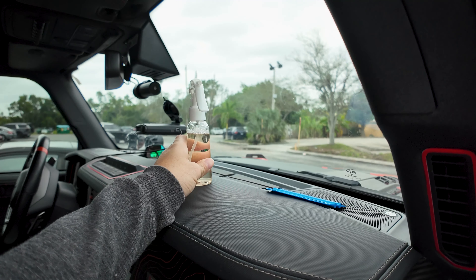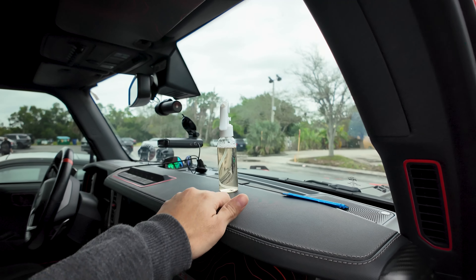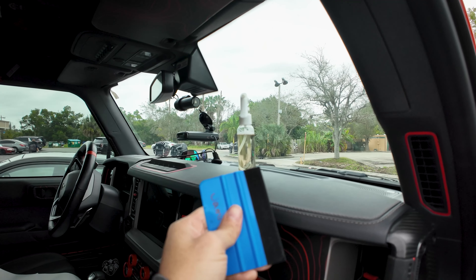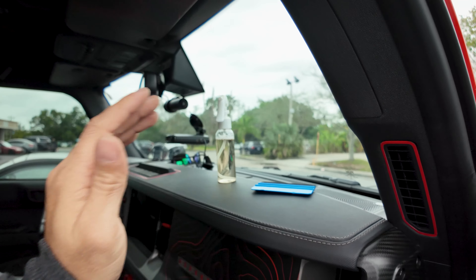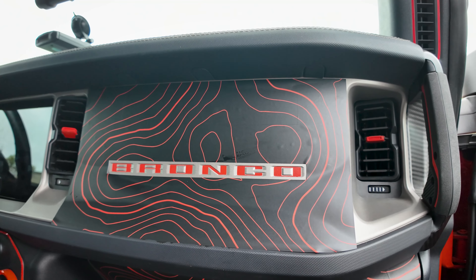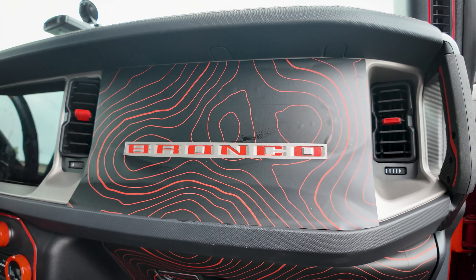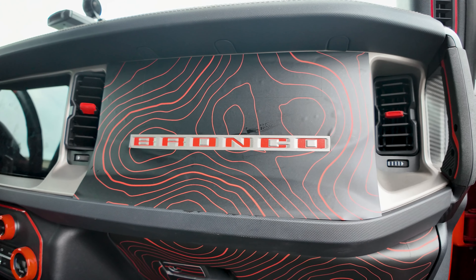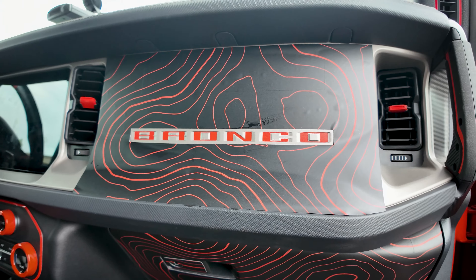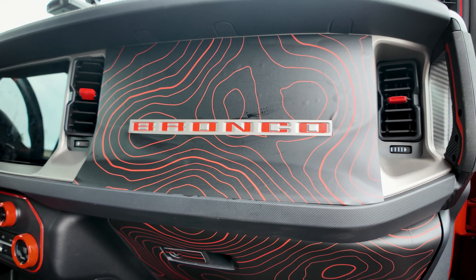I've been using Sigafab application fluid to break up that initial tack with the adhesive, and then using a felt tip squeegee — all of this can be found on our website. Ideal weather to do this in is 75 to 85 degrees, but since this vinyl's inside, if it's really cold in your area, go on a trip with the vinyl in your vehicle and then do the install. Your cabin will be warm, your vinyl will be warm, and you'll be good to go.